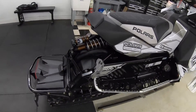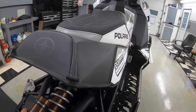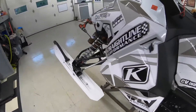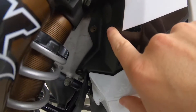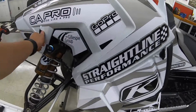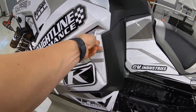These are a little tricky with the under-seat one because you've got to actually pull the seat out. I'm going to tackle the front though - the fronts are pretty cut and dry. The one little trick is there's this little tab right here that you've got to pull out so you can get the bolt through. Obviously, start with the side panels.